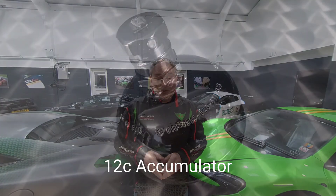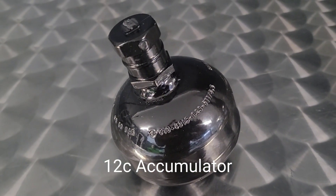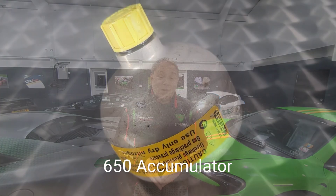Now, the 12C accumulators tend not to fail as often — it's a better item, frankly. Sadly, the design was not carried over to the 650S or 720S, just to make life complicated. So you'll get a PCC fault on your dash which will normally indicate it. If it comes straight after putting the car on lift, it's even more likely to be an accumulator fault. It could also be low fluid or other reasons, so don't immediately assume the PCC fault means an accumulator fault — but it's likely.